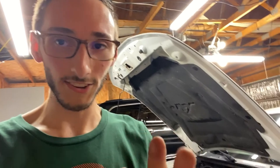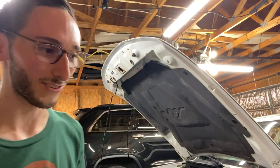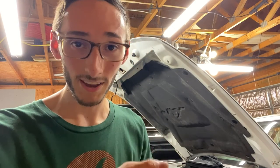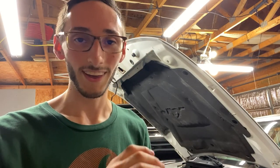It's definitely not necessary, but I like to take the extra step because it's my daily driver and I need to make sure it's in tip-top shape. Or if you're dealing with a customer car that has so many pieces into it, I imagine you would feel more comfortable priming the oil instead of just firing the motor right up. But that's totally up to you.